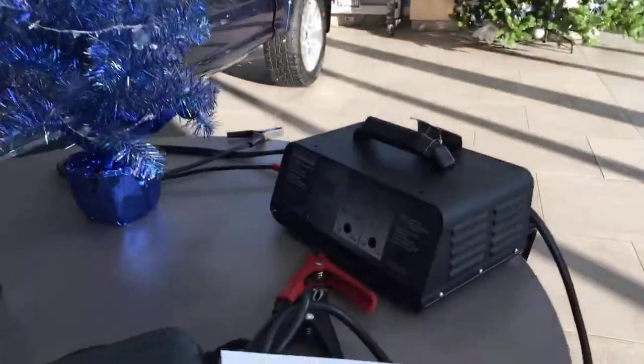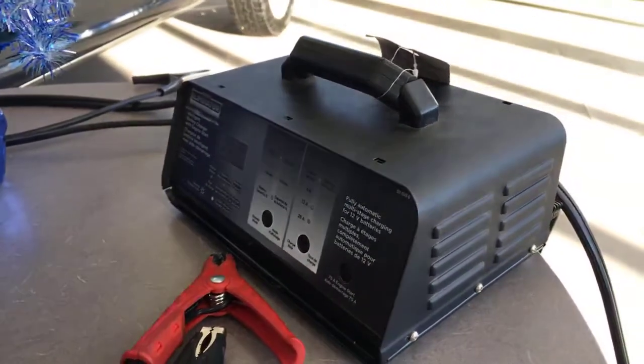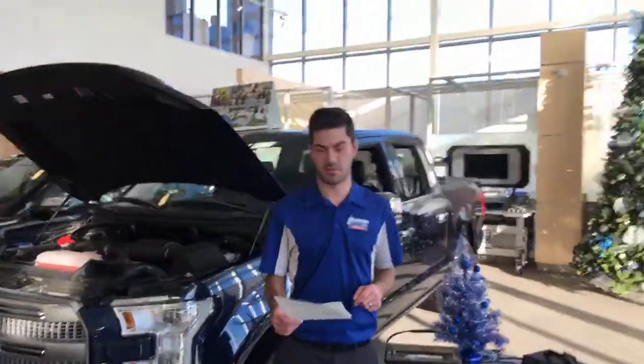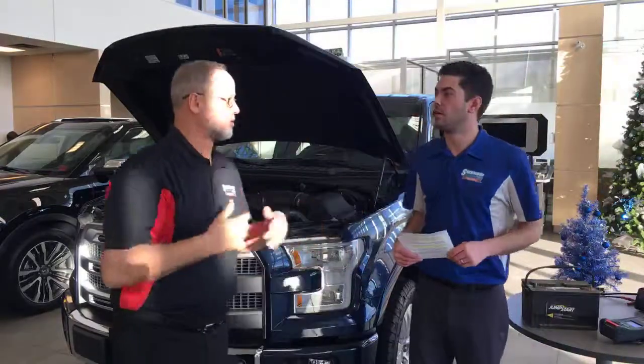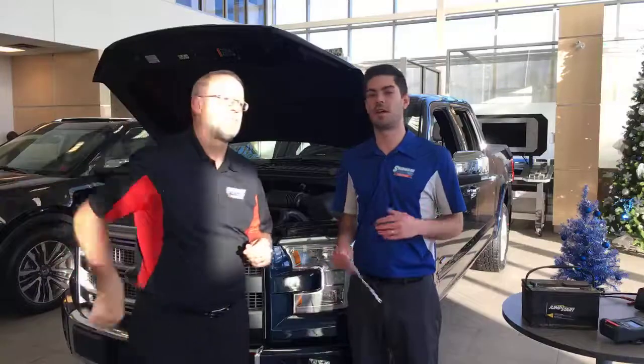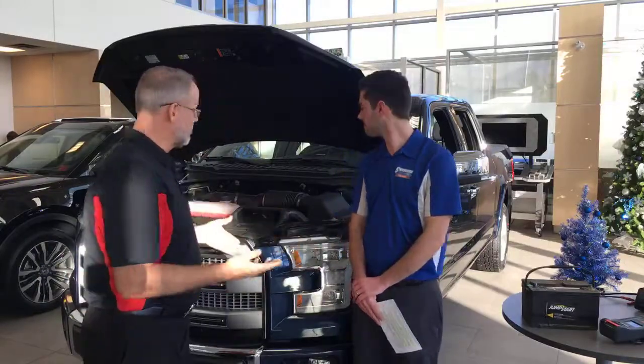If you're doing short commutes, that battery is not going to get enough recharge from the alternator in your vehicle. You'll constantly be losing a bit of the power - kind of discharging. What you can do is use a smart charger that will help keep your power level topped up all the time. We've got one right here. You can connect it to your battery and it's going to make sure it's charged - it turns off when the battery does have full charge, so you don't have to worry about overcharging and causing damage. Discharged batteries are eventually going to lead to a dead battery, especially with a five-minute commute.